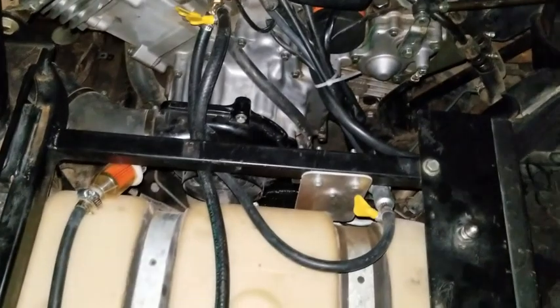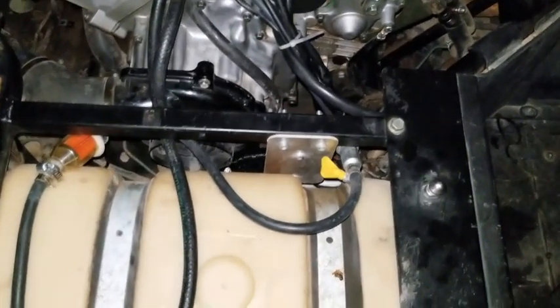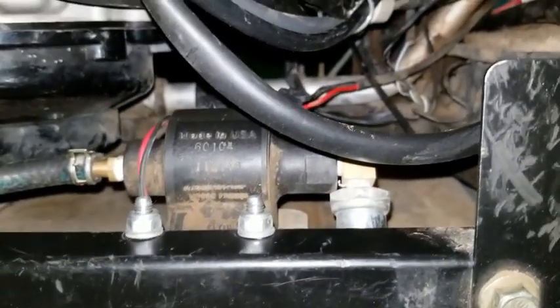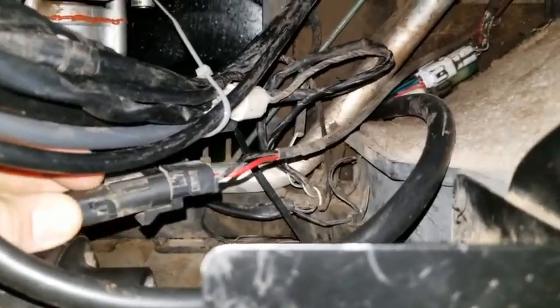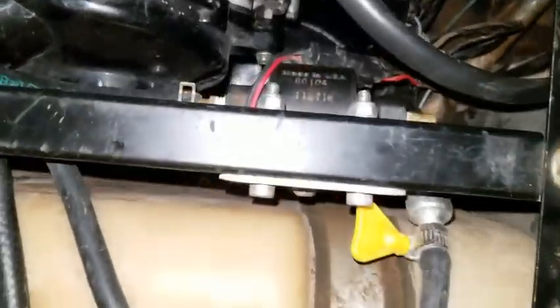People were asking a question about this 2004 Yamaha Rhino and how my fuel lines are set up. That right there is my Black Rhino fuel pump. I had to make a relay for it because it didn't come with one, and they said not to hook it up to the ignition because you're going to have issues with it later.